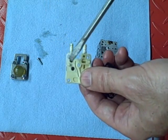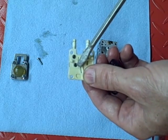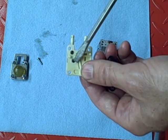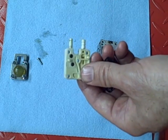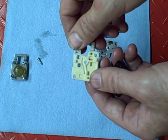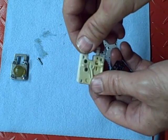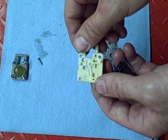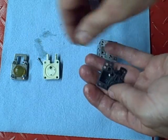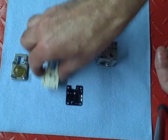These things right here are check valves. This is why I never spray these diaphragm carburetors with carb cleaner — one reason is because of these check valves, and also because of all the plastic pieces; carburetor cleaner is too strong. I'm going to clean this carburetor using an ultrasonic jewelry cleaner with a cleaning solution and water. I've found that's the best way to clean these. I'll lay that down in order so I know how to reassemble everything.